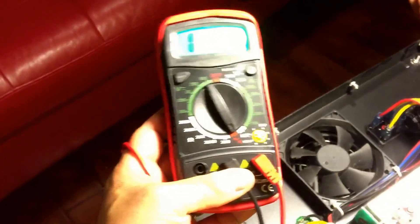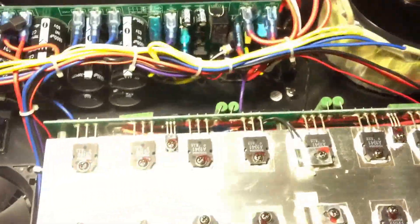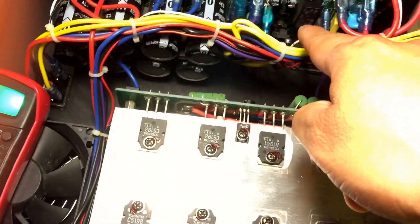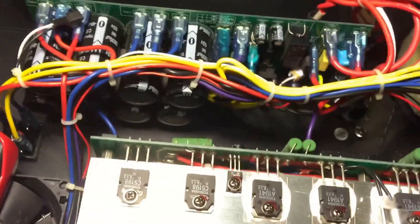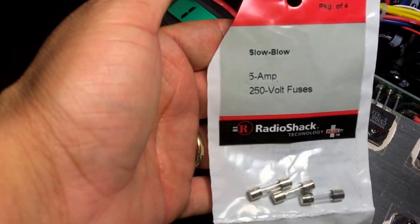What we did is use a voltmeter — you can get one on Amazon very cheaply; I got one for about eight dollars. I didn't know how to use it so my brother figured that out. We tested all the fuses for voltage and amps, and they all tested fine except this one. You couldn't visually see that it was burnt out, but when we tested it there was no voltage or amps coming out of it, so we knew that was the problem.